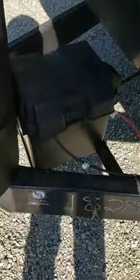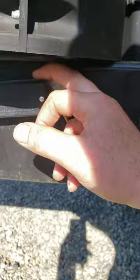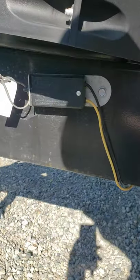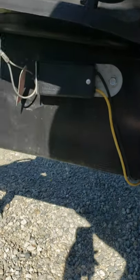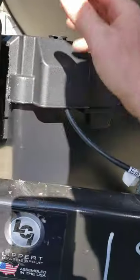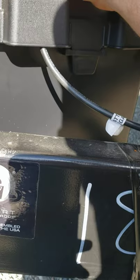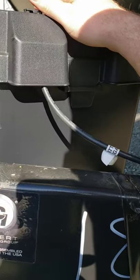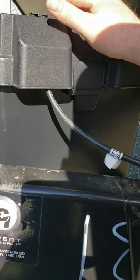You've got your 12-volt battery that's fully charged. Along with the 7-pin braking operation, you also have a trailer breakaway switch right here on the side of the frame. If the trailer becomes disconnected from the truck, it will pull this pin and apply the brakes as a safety feature. If your battery is dead when that happens, the brakes won't apply — so it's very important to always travel with a fully charged 12-volt battery.